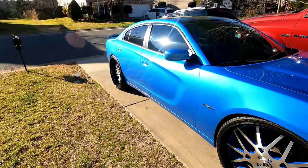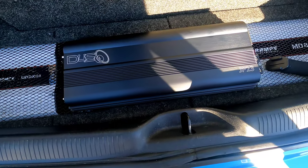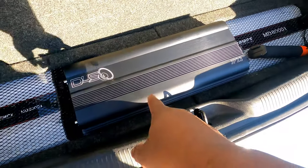This is going in the Charger. We're comparing it to this Taramps unit right here — this is the two-ohm version, the MD3K from Taramps. I have dual two-ohm SA12 Sundowns, so I'm going to wire them to a half ohm on the JP23. Let's do a size comparison for a second — this is why I love Brazilian amps. The JP23 does rated power and it is less than half the size of the Taramps.